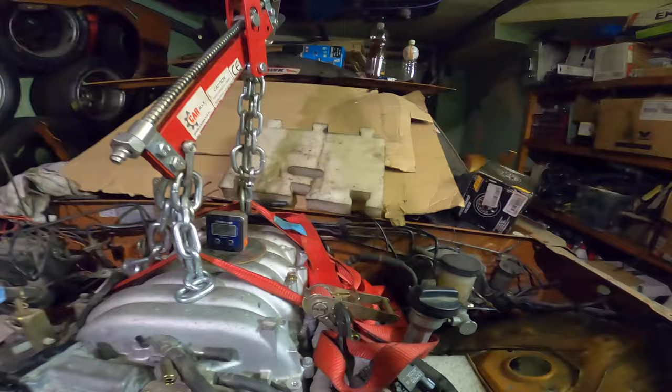The engine is aligned, it's all leveled, looks like the hood can clear. It's straight, which is kind of challenging. Looks like I'm where I want to be. Look at this, that's 0.5 degrees off. I would say within a degree of anything, I don't care really, because that thing is not accurate enough anyway. I have the engine mounts there and I have the transmission mount there.